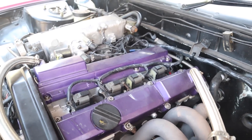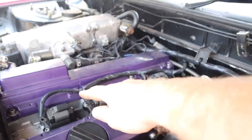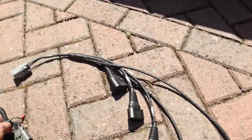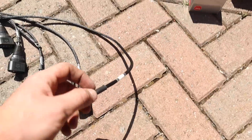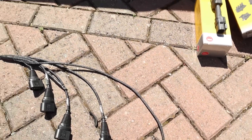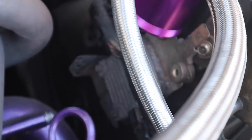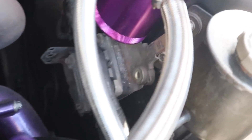Here is what my coil packs and coil pack wiring loom looks like before — it's old, it's crap, it's disgusting, and that's me trying to tidy it up with tape. Let's get these coil packs off. We have two grounds in this new loom — an engine ground and a chassis ground. That means we can remove this horrible igniter. It looks absolutely disgusting, it's so brittle and old, and I'm just so happy we can finally get that removed and put the bypass through.